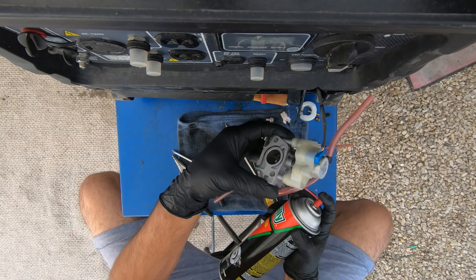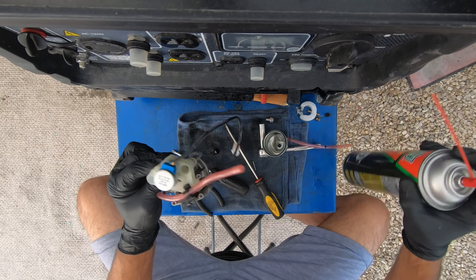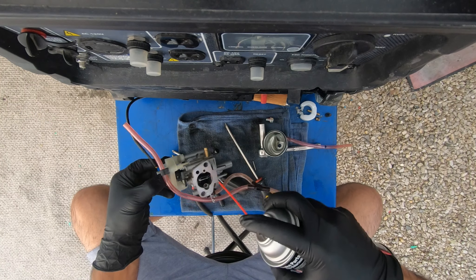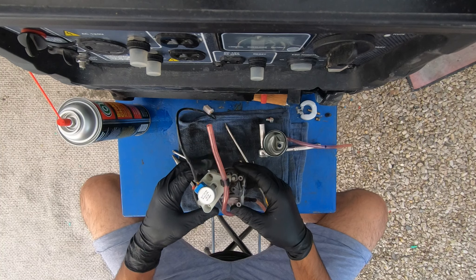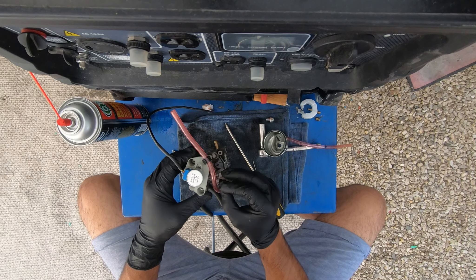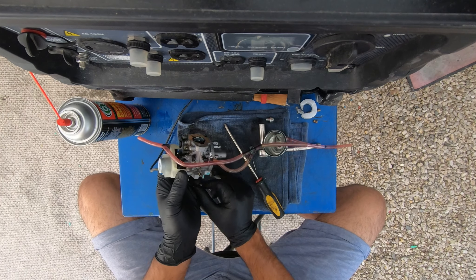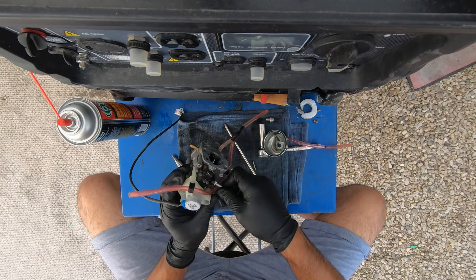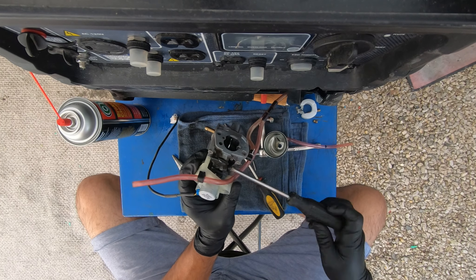That's where it flows — I think this one goes to the bottom. And the last one is where the gas goes in. You can also spray the mouth of the carburetor — a lot of stuff sticks to it when it starts to suck in oil. Here's a tip: if the carburetor is consuming oil, it may mean you need a new air filter, because that crankcase breather hose is what actually brings the oil into the carburetor when the air is restricted by a dirty air filter.